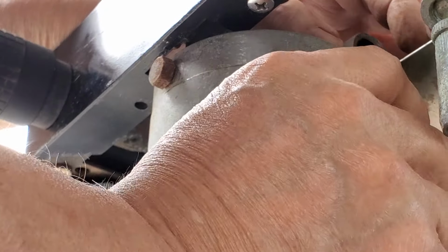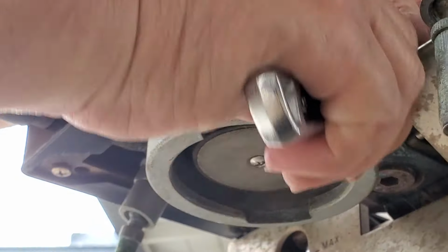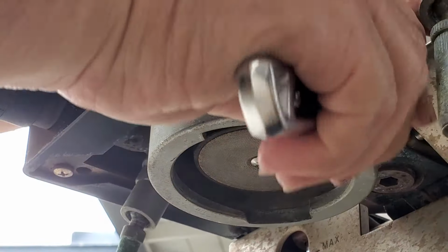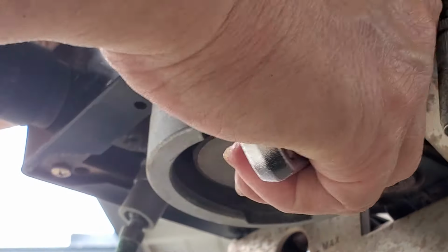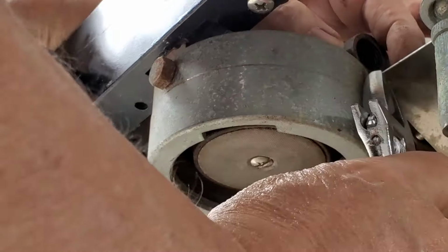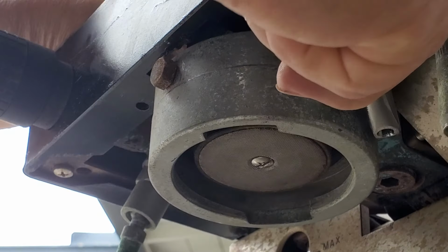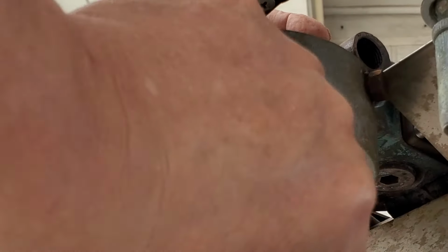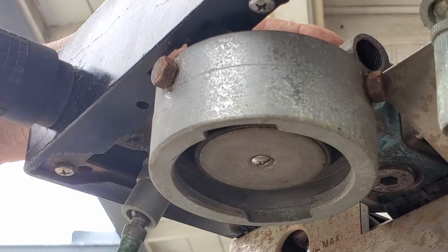If you ever have to replace these, you're gonna need to actually replace it with the actual bolts, because these are tapered. You can't just go to a store and buy a metric bolt and expect it to work, because it'll move. The cowling will move around because it's under a lot of pressure because of the portafilter. Okay, so these are snug down. Okay, there you go.